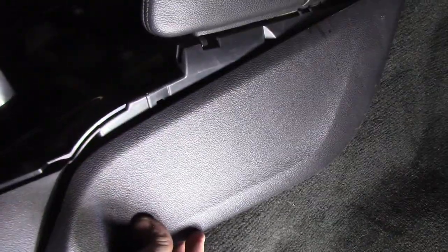Here's the carpet back in the car — sorry the lighting isn't great. It's a little bunched up where the bump is, but it lays in there pretty well. Once I get the console back in, it'll pop in there and cover it up even more. Once you get the seat in, I think it will be basically unnoticeable. I want to drive it around before I put the console back in so I can adjust the shifter and everything. One last shot — I had to do a little trimming on my Ford Motorsports Mustang floor mats, and that actually helps cover up the crease in the carpet. I just notched it around the bump, and once you put the seat in a normal position, you'd really have to point it out to notice it.